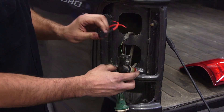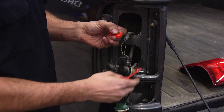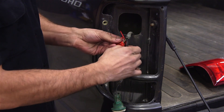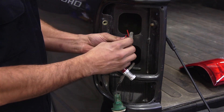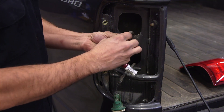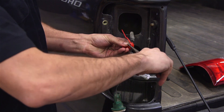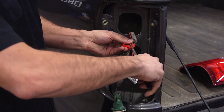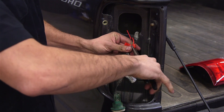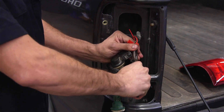The first step is to take your resistor and a quick splice. On the quick splice there is a stopper on one end — that's the end we'll put our resistor on so it'll be on the inside, and then we'll put the ground wire in the outer groove. Make sure it's all the way in and not misaligned. Then take pliers and squeeze down on the metal part, making sure your wires are all the way in and lined up before you squeeze.